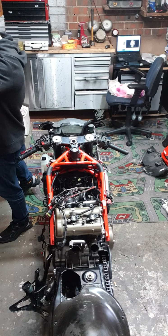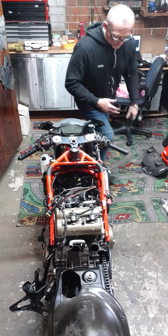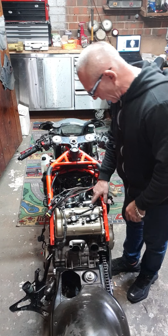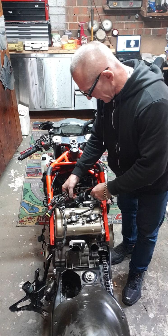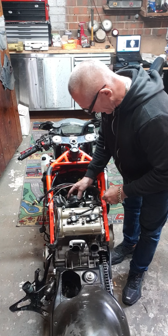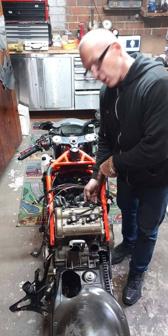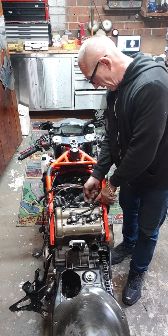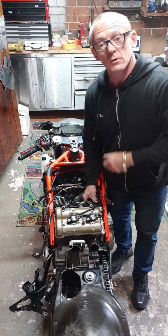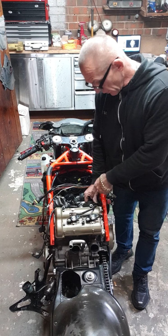So anyway, as I'm going along, checking the bike, finding more wrong. Well, this is not wrong, but it's things that went right. I had to drill a hole here in one of the inlet ports, because what he'd done is he put it on there, and it takes three Allen key bolts to hold it there. The front one, he obviously caught the thread, crossed it, and it got tight. Instead of checking to see what he'd done, he just left it and tightened up the other two.